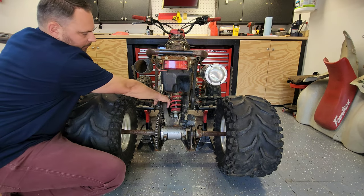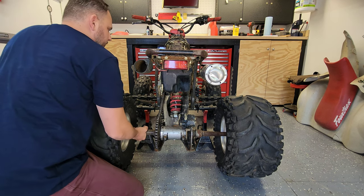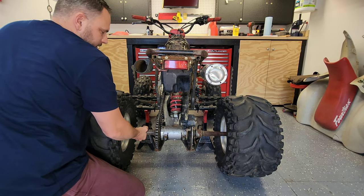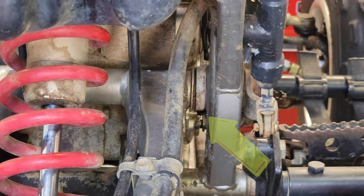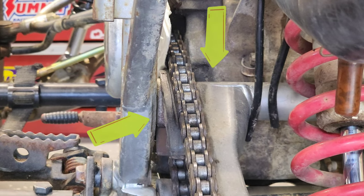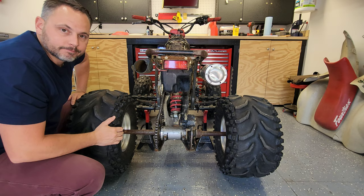And then to check the upper swing arm or the front of the swing arm, check those bearings. You just want to pull it forward and backwards, very close to the same movement. And you're looking for any play up there in the front. Okay, let's change it.